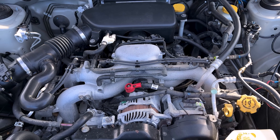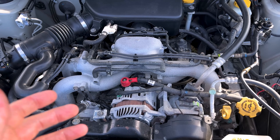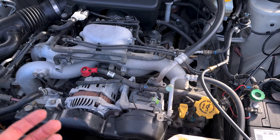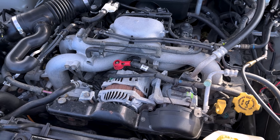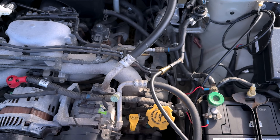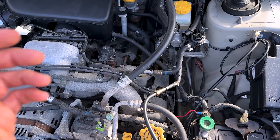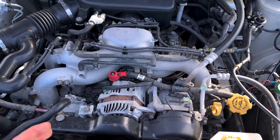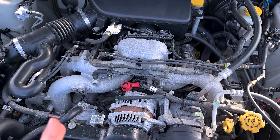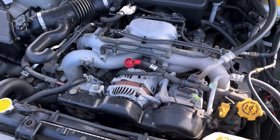I know a lot of you have asked me questions in the past about EVAP codes and EVAP diagnostics, and it's really impossible for me to give you any guidance online in pointing you in the right direction to diagnose EVAP systems. Hopefully this video has shown you that it's very hard to just take a guess at what could be the cause of a leaking EVAP system — there are literally feet and feet of hoses, solenoids, gaskets, all kinds of things. It doesn't take but the most minute small leak to throw a check engine light sometimes. You've got to have the smoke machine and the proper test equipment. A lot of times with EVAP stuff, it's not DIY friendly — it's better to pay a competent certified technician to do the diagnostic work and maybe the repair for you, because the proper tooling is not cheap and is not DIY friendly.